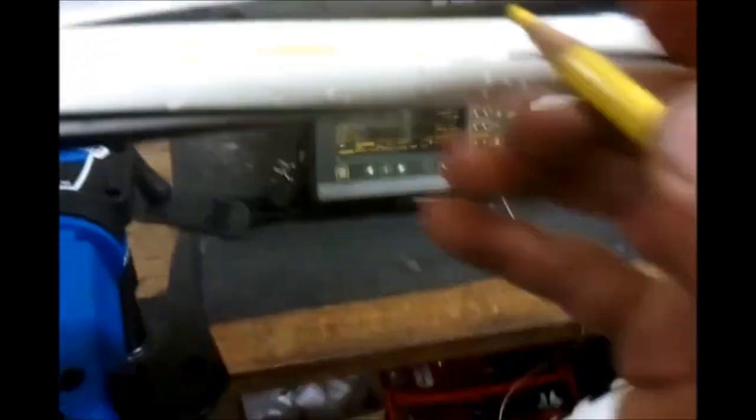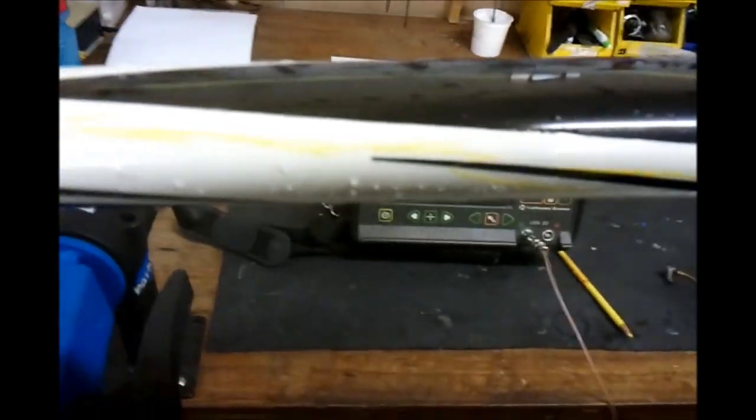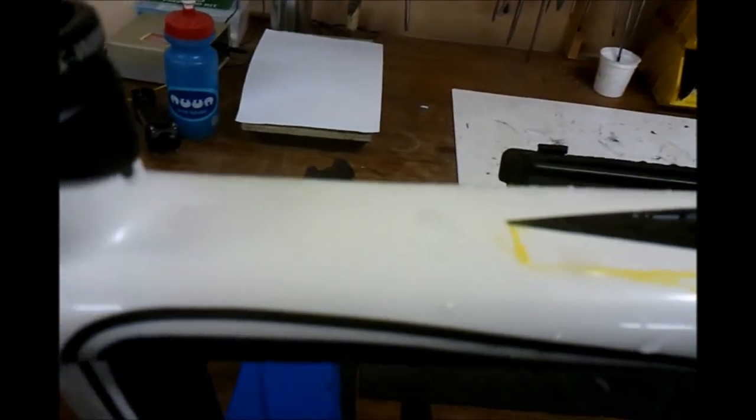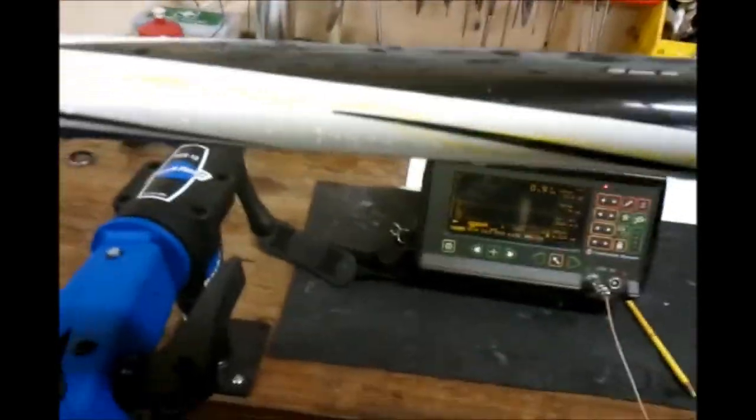There's a long piece of damage — a long delamination. When the shock of the impact occurred, it caused the delamination up that full length of the tube. So this bike is pretty much dead.